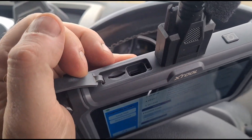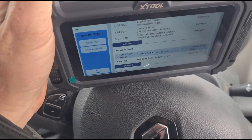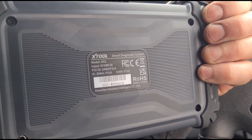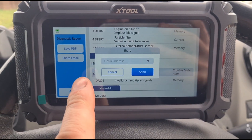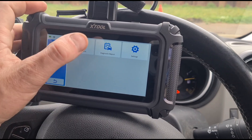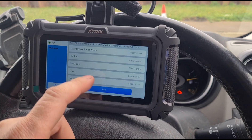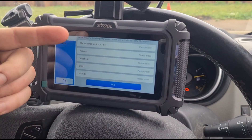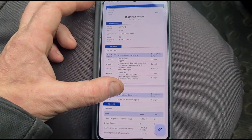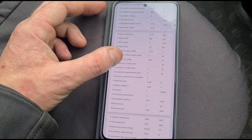We can see up the top here we've got a removable panel where you can charge it and you can fit a memory card in there. Of course there's your on and off button — it doesn't have a stand on the back. You can send an email report to the customer of what fault codes we have. Once that's been sent we'll get a report that comes to an email address. You can save your workshop details in there and that will be attached on the header of the report. It will come as a report like this — you can download the PDF — and you've got a copy of all of the faults listed on the vehicle and all of the live data as well.